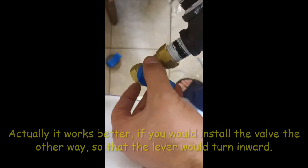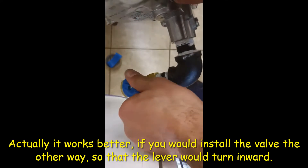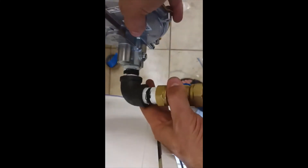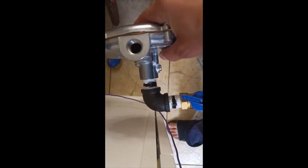This is the way I would put it in - it's on the outside and turns this way. This is open, this is closed. This is the whole regulator; whether you go this way or that way has to do with where the gas is coming from. You don't want the gas pipe coming from near your exhaust - that rubber pipe I showed you at the beginning could melt. If you go this way you have to pull this forward and upward. I'm going to mount it on and start telling you what to do next.